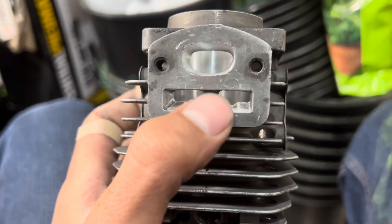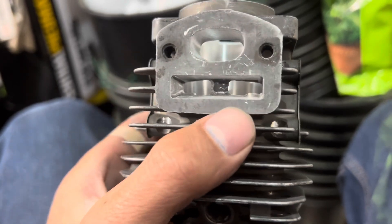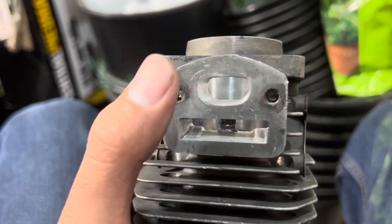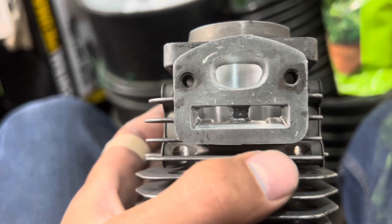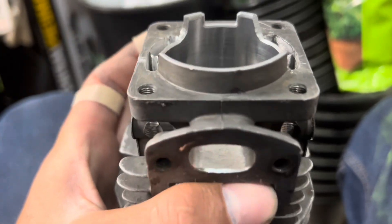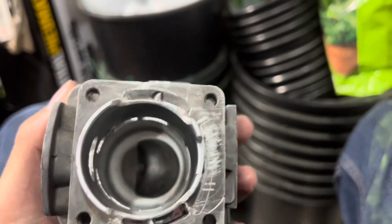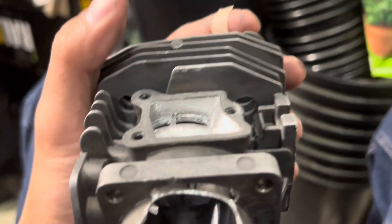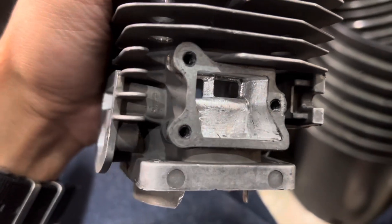I wanted to take another eighth off each side to slim up the divider but didn't get around to that. I just kind of roughed everything up that I did touch. The intake I did widen a bit and just drop it just a hair, and then I just roughed that up all the way around — because you couldn't get too crazy there. As you can see, you'll eat through the wall pretty quick; it's just the way these are cast. I widened the transfers and did not raise them, but I just roughed everything up.